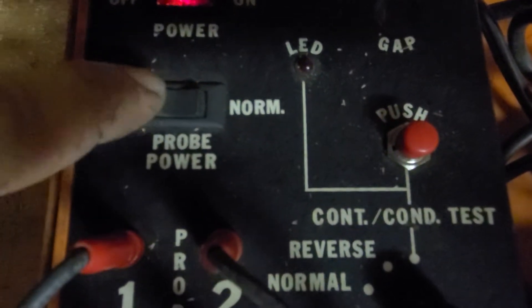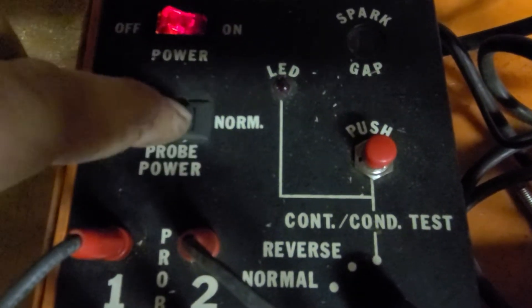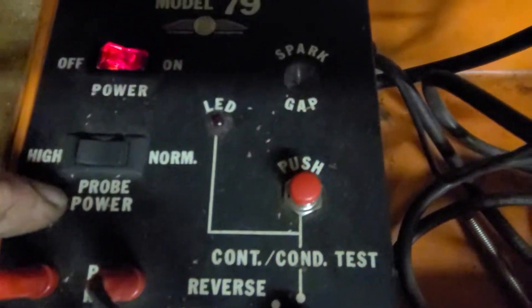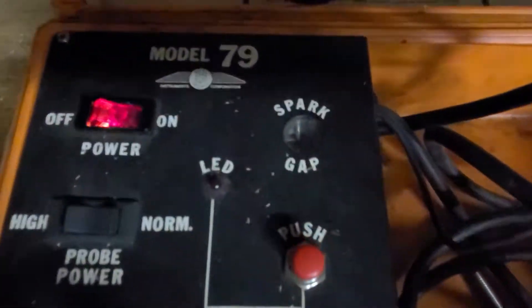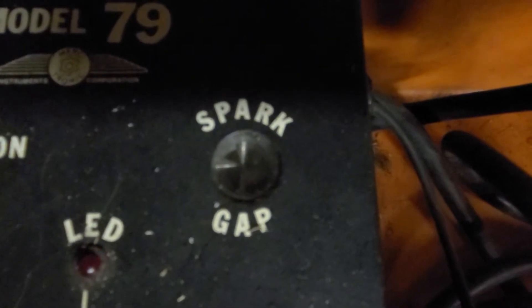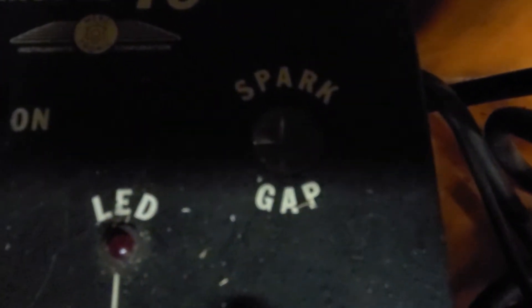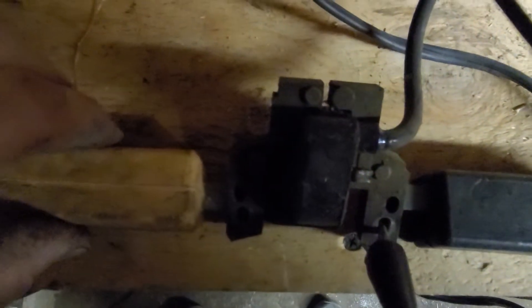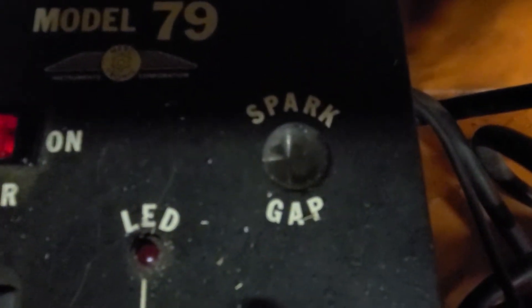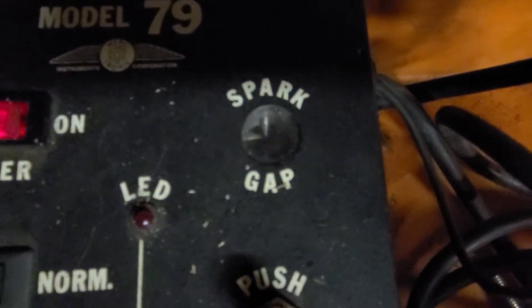On the larger four-stroke coils you use the high power mode, and on the smaller two-stroke coils you use the normal power mode. So if we have this all together correctly and we hit high power mode, we should see spark — there you go! You can see it sparking. As long as those are close enough, you can see it's sparking inside the window, which tells us that coil is good.